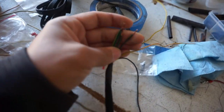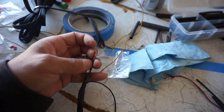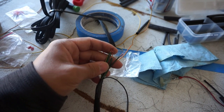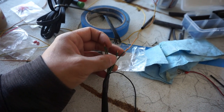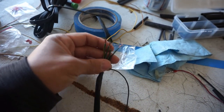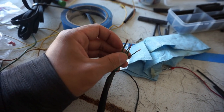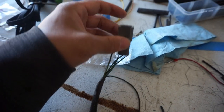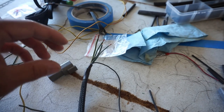Then we have all four of these — the green wires. These are signal wires going to signal on the ECU. I actually had a Link ECU plug-and-play, and it is a 205, which is for a Gen 3. The Gen 3 has a different circuit board than the 185, the Gen 2. This is a Gen 2 engine, Gen 2 harness, so I re-pinned everything to accept the 205. These are going to go right into the pins for ignition 1, 2, 3, and 4.